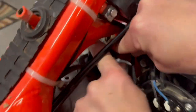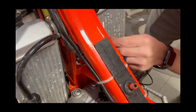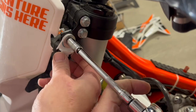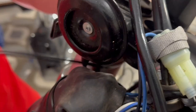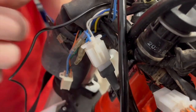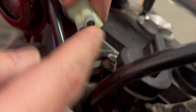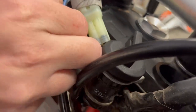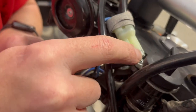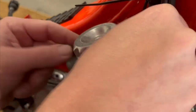Now I'm just going to press this boot back in place. The spark plug boot is back in place and I can route this connector up to where our Trail Tech is going to be. I'm going to take this headlamp off — just two 8 millimeter bolts — just to give a little more room back here. Looks like it was already broken. Just routing the wire and I'll zip tie it along the way. The previous owner also wired up a power cable connector here when they did the blinkers and the on-road kit, so I just need to put the Trail Tech wires into this connector. We do have power readily available when the key is turned on. Just want to make sure the wire isn't touching anything hot or rubbing against anything that will cut it, like a hose clamp.